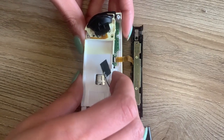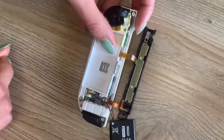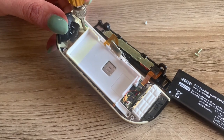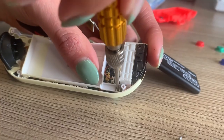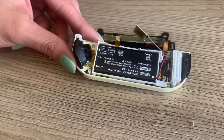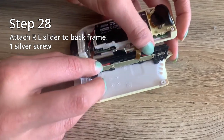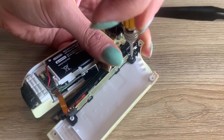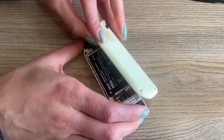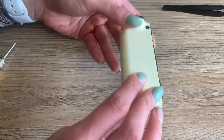Once that is in, close your middle frame. The antenna tucks in there, but we still have a couple more steps before we recommend doing that. Step twenty five is to reinsert your three golden screws. Once those are in, reinsert your battery. Then take your button from the old frame into your new frame and reattach the RL slider to your back frame with one silver screw, making sure everything lines up. Now secure your antenna on the side and close your frame — make sure the ribbons aren't poking out and that they sit nicely. Once you close your frame, it should be nice and flat.